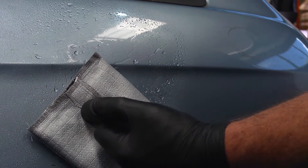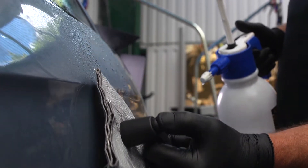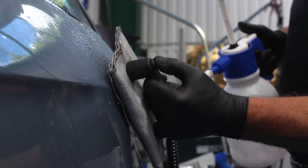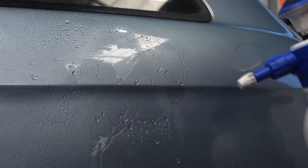The inductor heats the panel very quickly and you cannot see the amount of heat. You will see the water spray turn to steam though, and this visual heat indicator will reduce the chance of burning the paint.